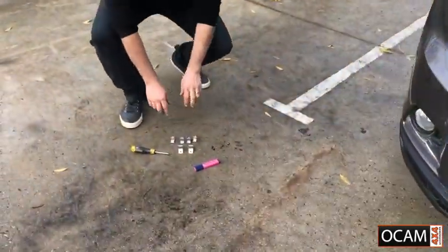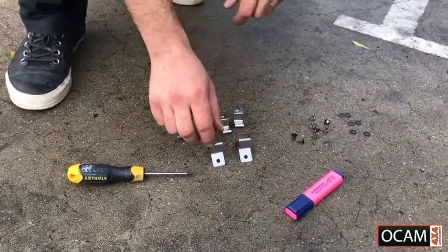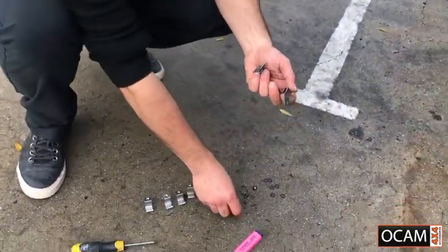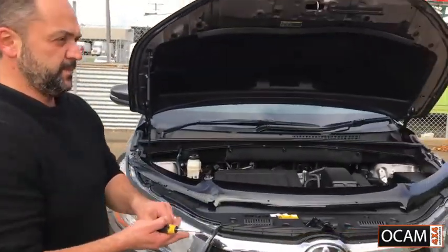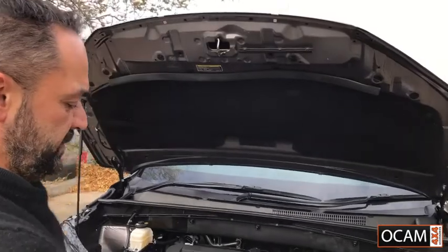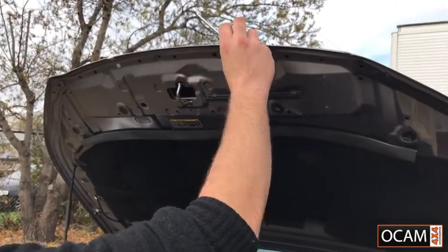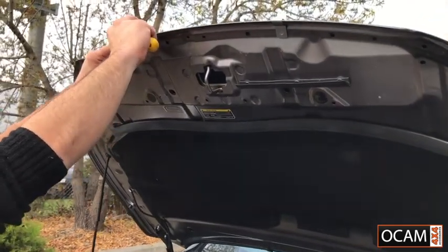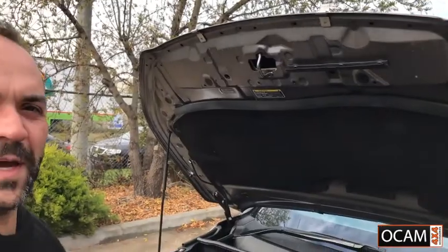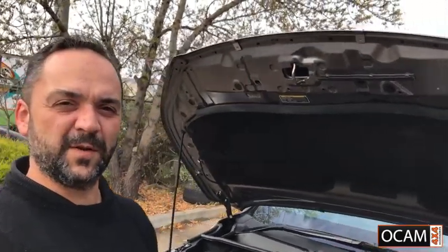Now in the kit, you've got your 4 outer wing clips and you've got your 2 center clips. So we'll take the 2 center clips and our 2 self-tapping screws. We'll pop them over the anti-abrasion tape. Also very important to ensure that none of the metal clip is touching the paintwork. Make sure it's all resting on the tape.